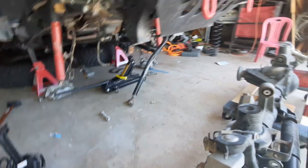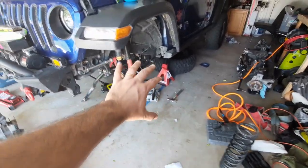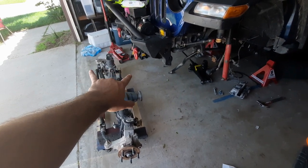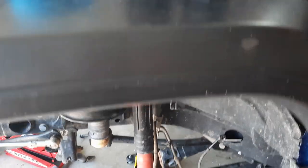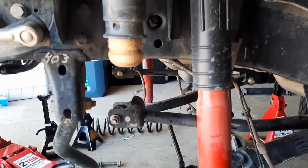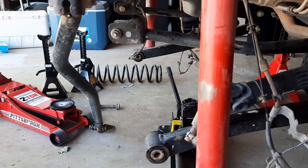The challenge was getting the axle down onto the floor dolly, because the axle rotates depending on how you lift it. I did one side at a time slowly, put two jack stands — one on each side — to keep it stable and dropped it down. With the axle out, I'm also installing the Metal Cloak upper bump stops since I have everything apart. The old ones just spin and pull down, the new ones go right back up. Pretty simple.